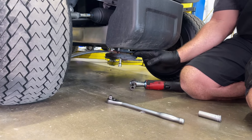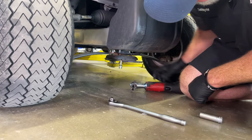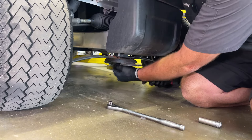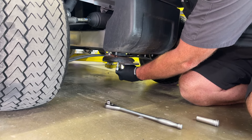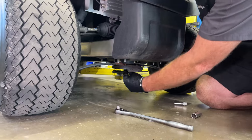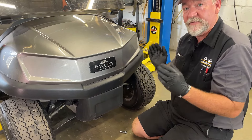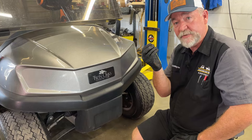To tighten it, you want to adjust and tighten this up so it will hold your camber adjustments. What I do is I hit the 13 millimeters first so that cam bolt can't move, and I'll do the cam bolt last — but it's kind of your preference; you can do the cam bolt first if you want. Always make sure you tighten the cam bolt. In my opinion, doing the 13 millimeters first keeps that leaf spring from shifting. Sometimes when you hit the 9/16 or the 14, it'll turn a little bit on you and you won't realize it.